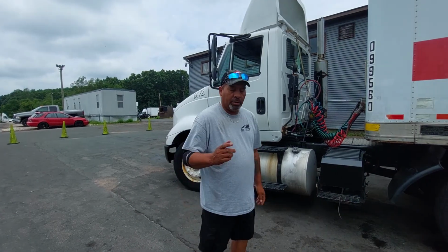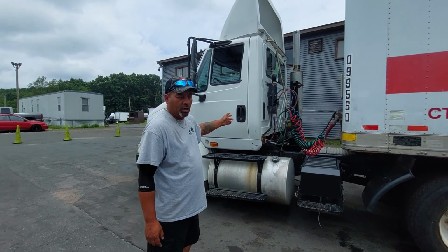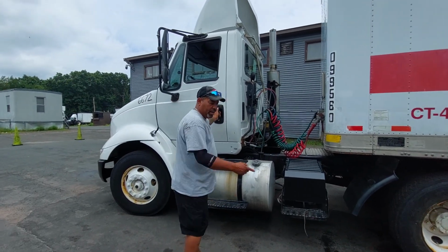All right. First thing I'm gonna do is secure my vehicle. I'm gonna make sure my brakes are set. My truck's in the lowest forward gear. I'm gonna take my key with me. Then I'm gonna chock my wheels.